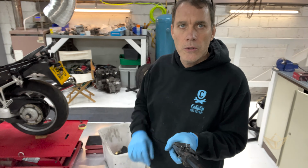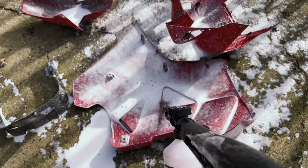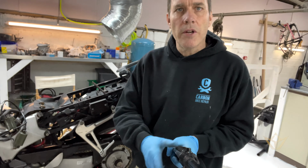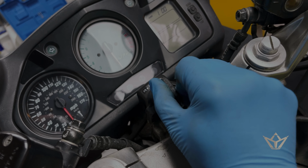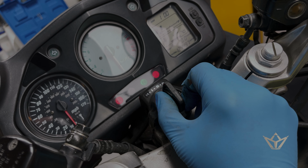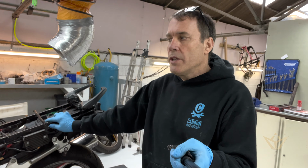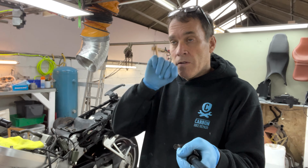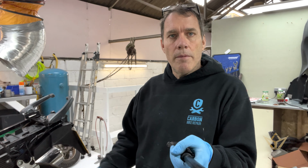I just want to take you through some of the things since the last broadcast. You can see here these panels, we're getting ready to repair those. As far as the VFR is concerned, I can't get rid of the flashing red light. Over time, after I started, the bike started to run rougher and rougher, there's a lot of black soot in the exhaust pipe, which means that most likely the engine can't calibrate because there's something wrong with the actual FI system or the system of controlling the fuel air mixture, etc.